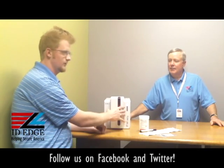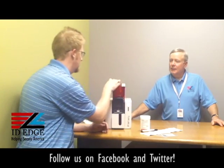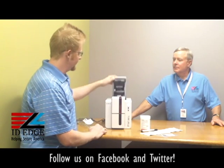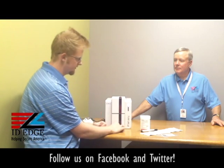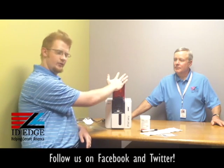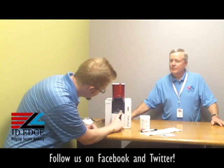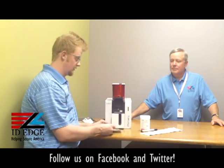Okay. First, we're going to want to remove all of the cards. So we'll just go ahead and do that now. And as well as your ribbon. Once all that's removed and everything's closed up, let it process itself. And we'll go ahead and open up the top of the card hopper, adjust your card gate all the way open, and you'll see there's a little cleaning indication over here. That just helps the cards move freely through the printer.